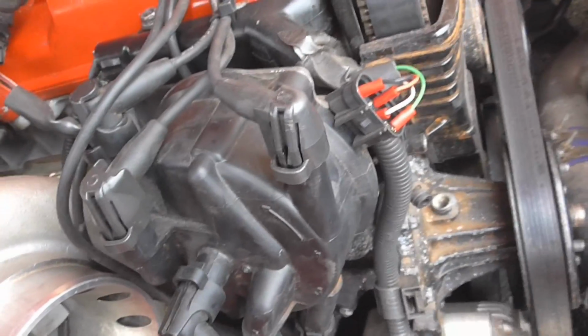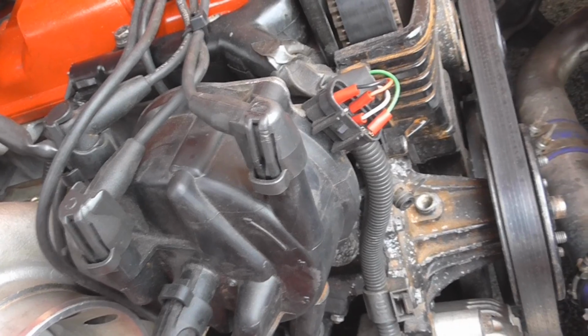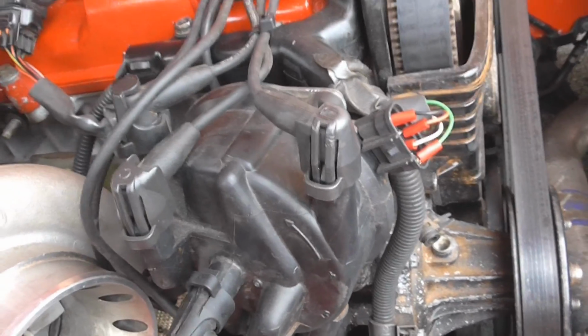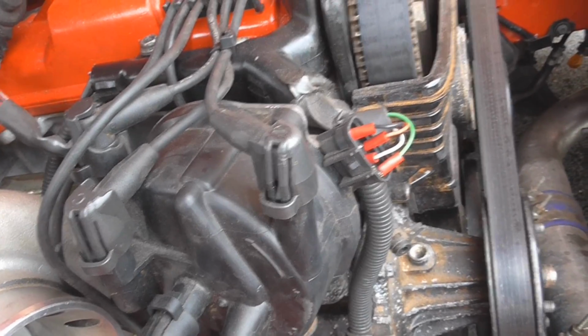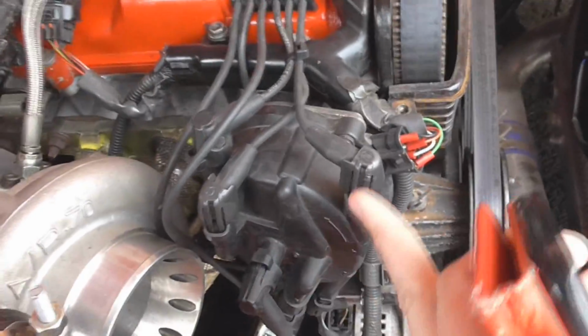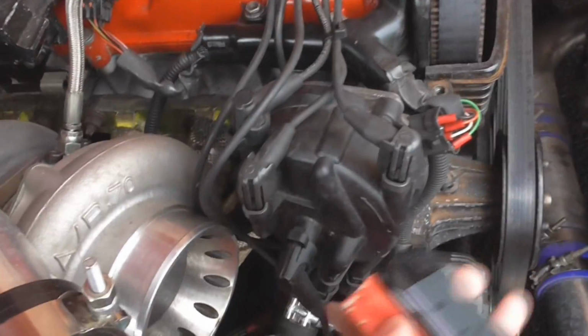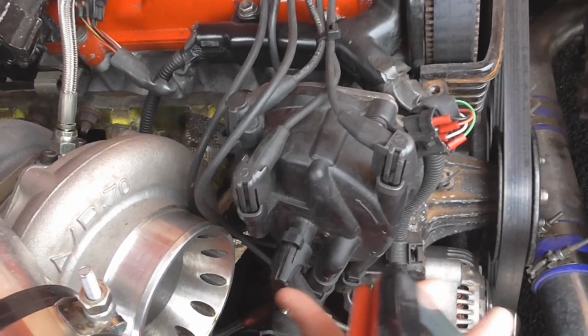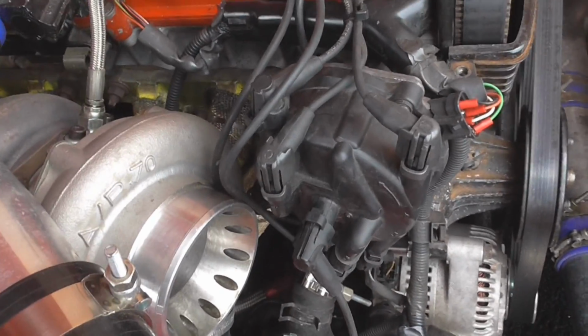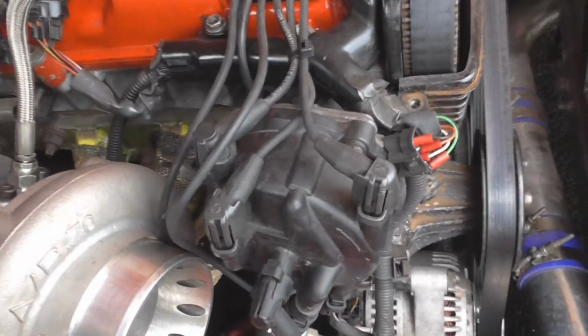The distributor is a Forerunner distributor cap. The rest of it is still the original Supra one. Ignore the damaged plug, as talked about in a different video. That was done by the mechanic who had it. He broke it, so I need to fix that, but it still works currently. Yeah, so it's a Forerunner cap because that allows these plugs to face up and down to clear more room for a pipe, like a silicone pipe, and then your filter to go on here. I just currently don't have it on the car at the moment.